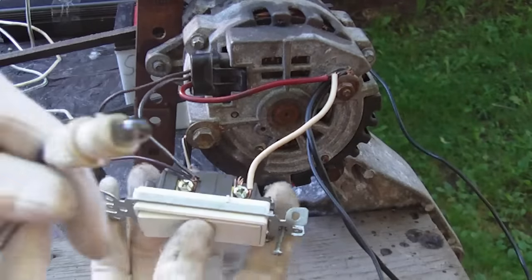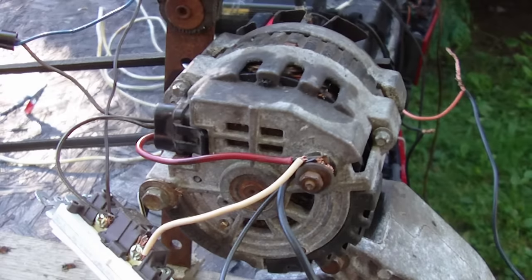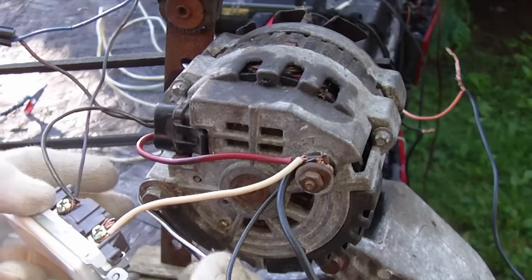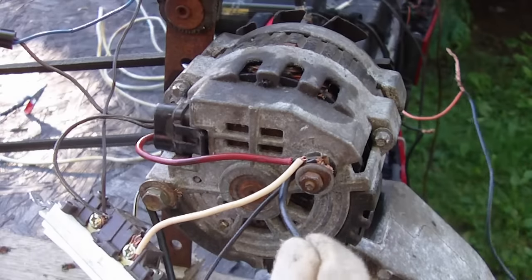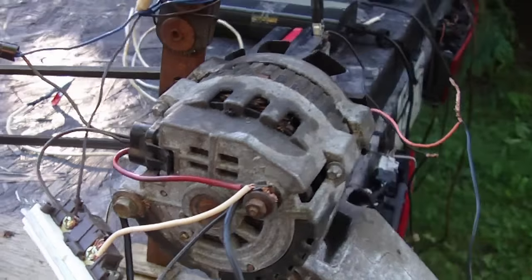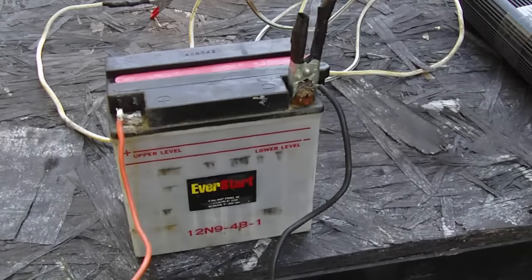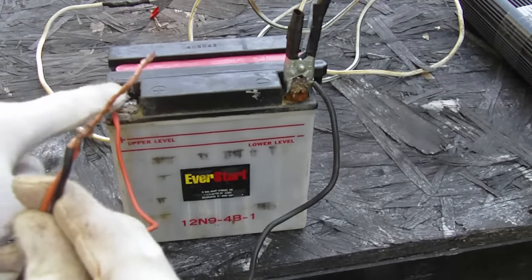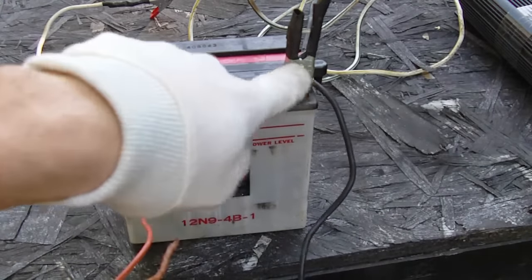You connect one end of the light to this wire and the other end to positive. These two are switched between the main positive or the battery positive to these two wires — you can switch it on and off. To hook this thing to the battery, it's really simple: you have your chassis ground, that's your negative. This wire here goes over to the battery, and then we have a positive coming off of the main bat terminal. The positive is connected to the positive of the battery, and the negative on the chassis of the alternator is connected to the negative on the battery.